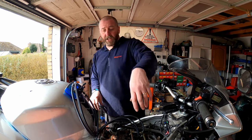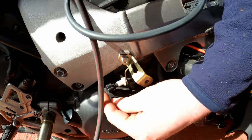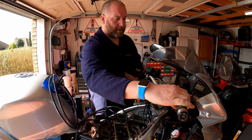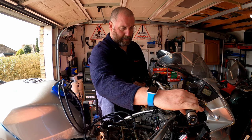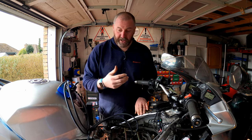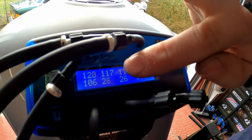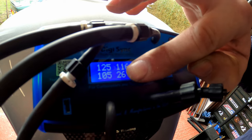To adjust the idle speed we simply turn this little handwheel here — if it's stiff there's a screwdriver head inside you can use. The engine was a little bit of a dog to start with sensors disconnected, but it's running now. Looking at the RPM it's a little bit low, so I'm going to adjust that to bring it up a touch. As you can see: cylinder one is 123, cylinder two is 117, cylinder three is 120, and cylinder four — the non-adjustable one — is 105.